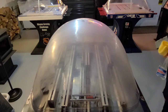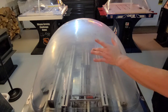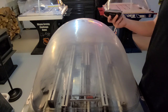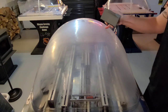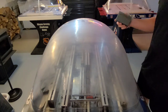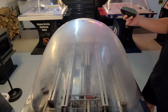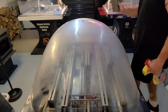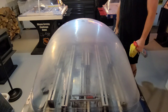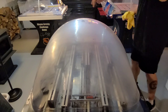Back with the 3000 grit. After the 2000 grit, it's starting to get a little clear, not as hazy. I used about four or five pieces of that 2000 grit on this — it does take multiple pieces depending on how bad the dome is. This one wasn't too bad, just four or five deep scratches, but it does take multiple sandpaper passes. You need the strength for it — you'll build it if you do it right. Let's go ahead and do the 3000.